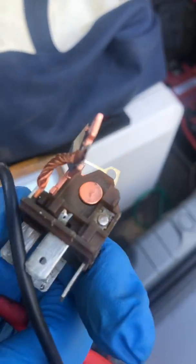We just cleaned it up and tested it again and it was actually working. So if you're in a situation where the relay goes out and you're in an emergency, you can pop off the little cap — it's got four little tabs on the underside, just use a little flathead screwdriver to pop it off. Take apart the relay, clean it up, make sure it's making contact. I kind of re-bent the arm a little bit closer so it connects more easily.